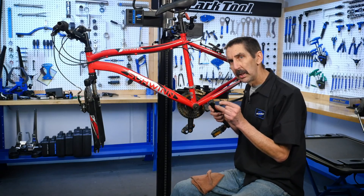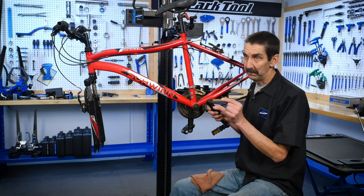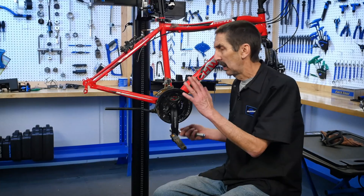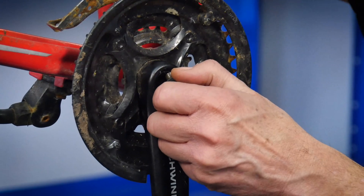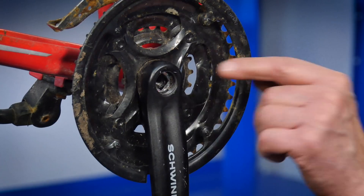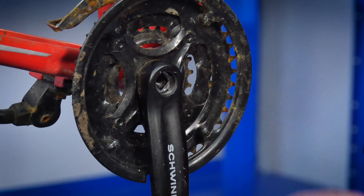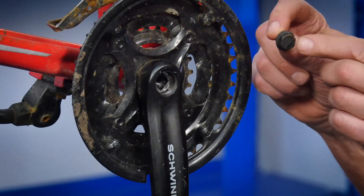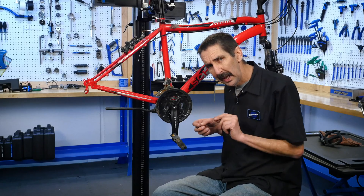Let's see what it should look like on the other side — let's see if it's any better. We're going to flip the bike. On the drive side, let's pull this bolt, have a look inside. Here the spindle does not come all the way to the end of the flat. Hence, this bolt is pushing on the arm to keep it tight on the spindle. It's as if you, the mechanic, are riding along with the rider with your thumb on here...